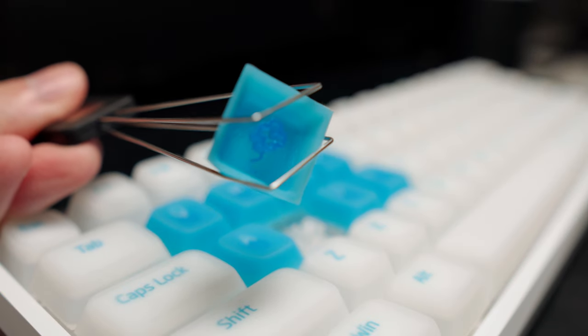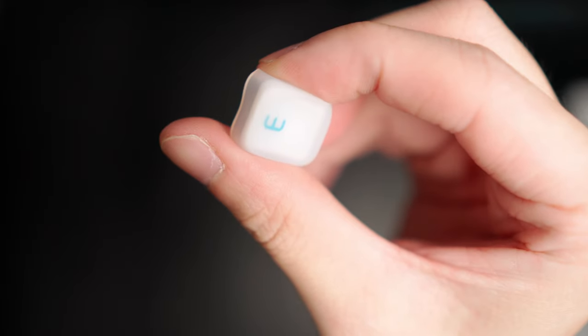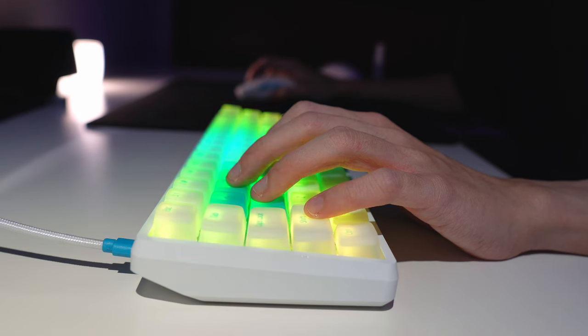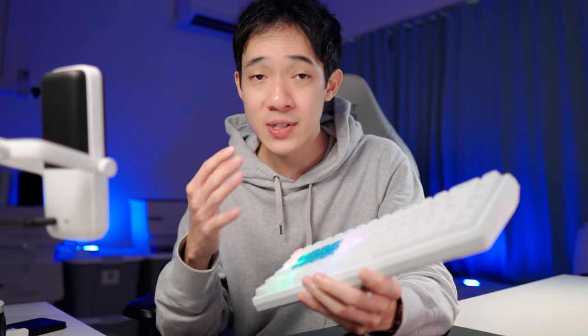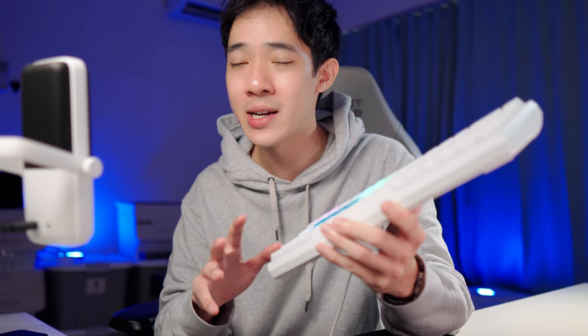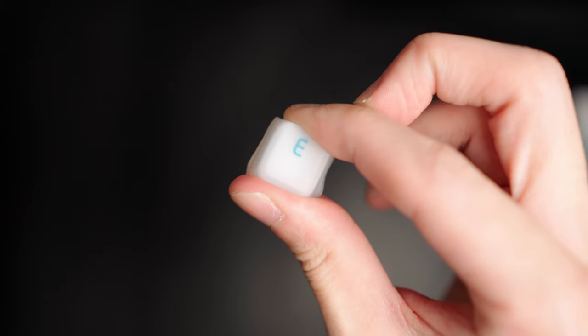With the Atlantis Pro keyboard you get silicone keycaps — these are essentially ABS keycaps with a silicone shell on top. Out of the box they come off very smooth, but give it some time and you'll notice the difference in grip compared to double-shot PBT keycaps. I do like the height of these keycaps though — they feel nice to game with. But if you ask me if silicone keycaps are worth it over the sound and quality of double-shot PBT caps, I would say no. That said, if you're a big fan of lighting, these keycaps make the RGBs look absolutely fantastic — like a rainbow cloud. Because of the silicone construction, the sound you get sounds muted and typing on them feels soft and kind of lackluster.